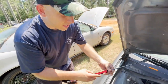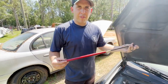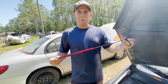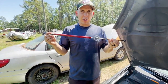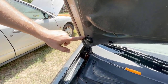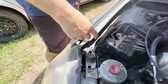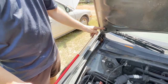So what you have here is they come in a nice package. You've got two mounts. These things are specific for your make and model of your car. So whatever car you have, when you go on Amazon to the link that's going to be in the description, you will put in your make and model for your type of car. So we've told them we drive an RSX. They have two mounting points. You've got one that goes up here to your stock OEM 10mm bolt for the top part, and then where your fender latches, it screws right into the hole. So very simple installation. All you need is a 10mm or whatever size your hood is.